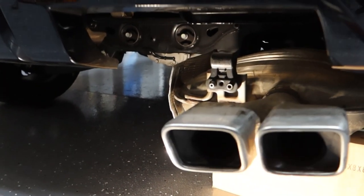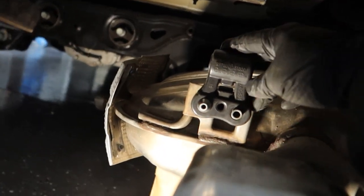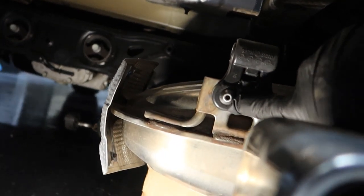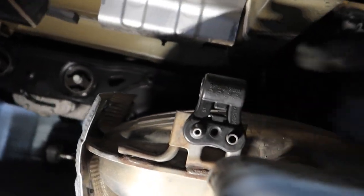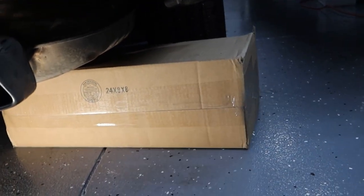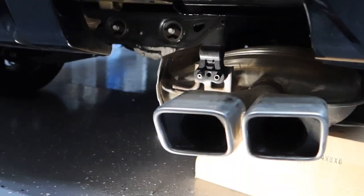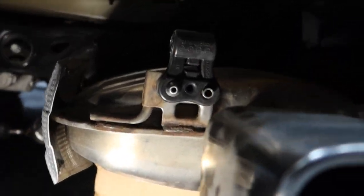This part is probably the hardest part about the job — taking off these rubber exhaust mounts. I suggest taking them off from the car side because these nipples or flares are bigger than the car side. I was able to get those off. I used a jack stand to support it and then lowered it on a cardboard box so I have room to work. You got to get four of them: one, two, three, four.